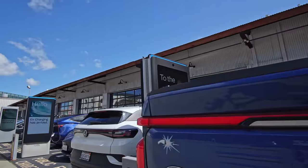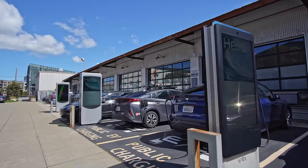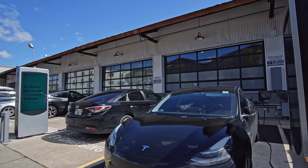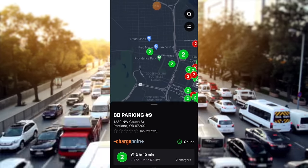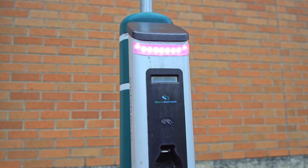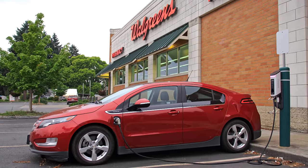There are very few people with off-street parking for whom one of those chargers won't work. You'll find them installed not just at homes, but also at workplaces and public places like shopping malls. They're called J1772 — or Chargeway Green 2. If you filter your phone's charging app by J1772 or Green 2, you'll see a lot of them around. These have been around a long time; sometimes they're free, sometimes they cost money, and they're useful if you're parked up for a significant amount of time — although some older networks have gone bust, so your mileage may vary.